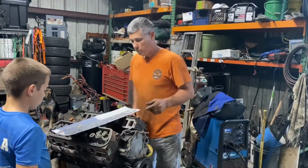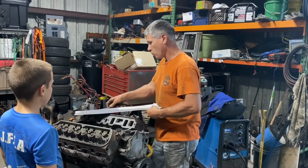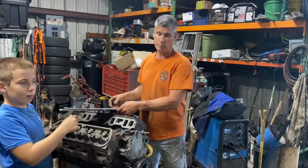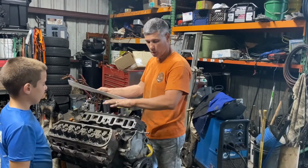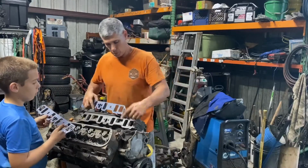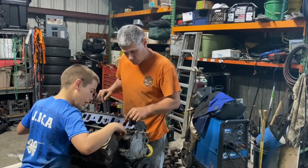I don't know if everybody knows, most everybody does, that in the kits, in the gasket sets, they'll send you cork end gaskets. Take those and take them out. Be very careful. Take them out and then throw them away. Because they tend to push out as soon as you get the intake torqued down. It'll sit there perfect, and one day you'll come out and you have an oil leak, and you'll wonder why. It pushes these out. This goes for water too. So you see how these little grooves sit right on top of the gasket right there. They hook on there.